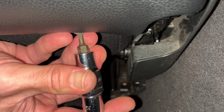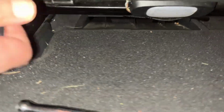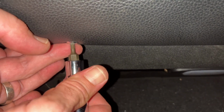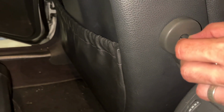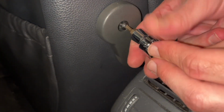Putting the screws back here in the bottom. If you have any clips, you can secure them back in the bottom of yours. In our case, we had these two screws that just hold the seat back in place. Thankfully, the lumbar support was keyed. If yours isn't keyed, you may want to take a picture of the alignment or the arrangement of any pieces before you disconnect them from the seat back.